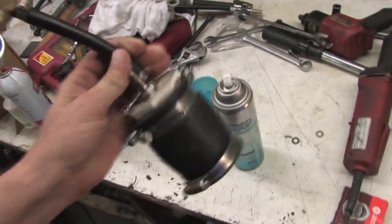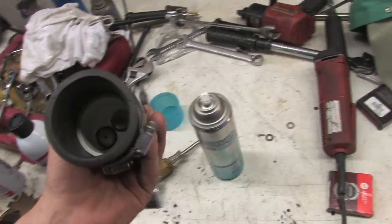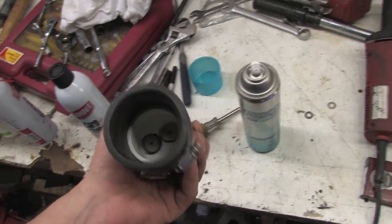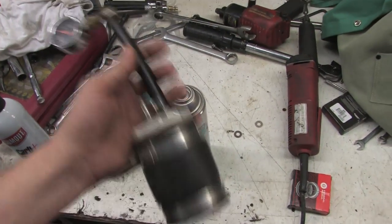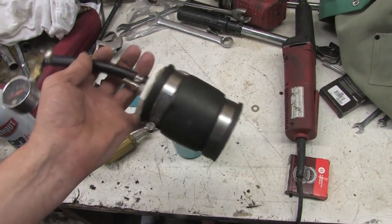So what I'm going to do is take my tool apart, first hairspray this top coupler so I don't blow that out, and then hairspray the part of the coupler that clamps down to the turbine inlet, and let that dry and set up before doing a boost leak test. When I hit 22 pounds last time I blew this tool off, which wasn't useful because I plan to run well more than 30 pounds through this engine.